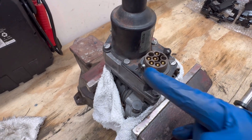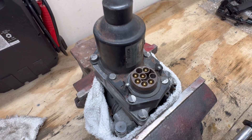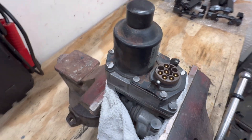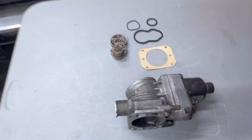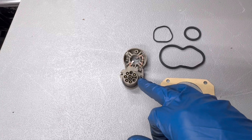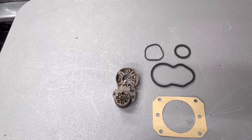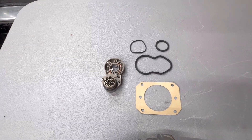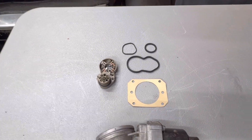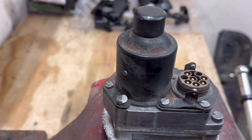I'm going to just slice into the security screws a little bit with a Dremel, give them a slot that you can get a screwdriver in and back those things off. You can reuse the hardware — that's not a problem. The kit comes with everything you need: a new throttle body gasket, the encoder itself, and a couple other gaskets. I'm going to go ahead and get set up and start on the other throttle body — you guys can follow along.